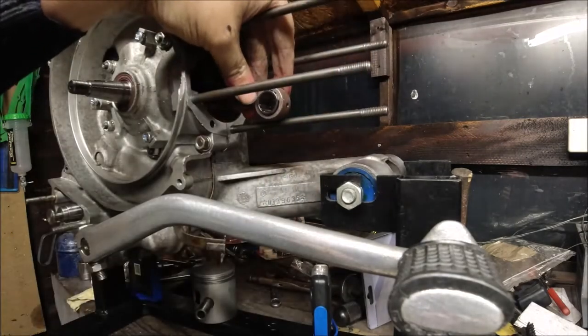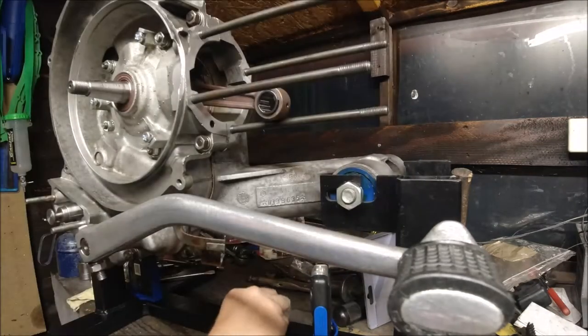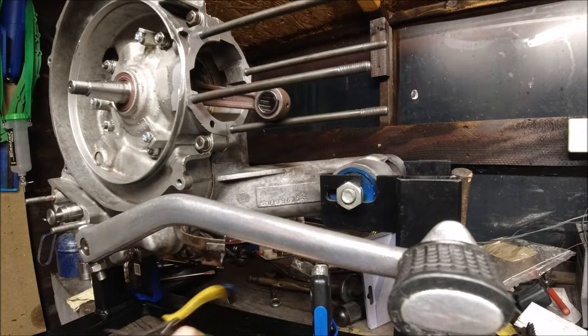Bear in mind, I've already wiped this crankshaft. With the piston, this one here is going to be a captive ring, so I'm going to stick that in with a pair of pliers. I'll show you how these go in — they are a bit fiddly, but they do go in, and again it's another thing that's easier when on the engine. The arrow's that way round, so I want my pin at the bottom pointing up.